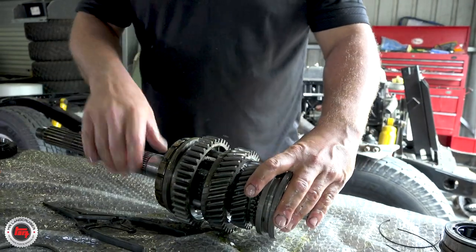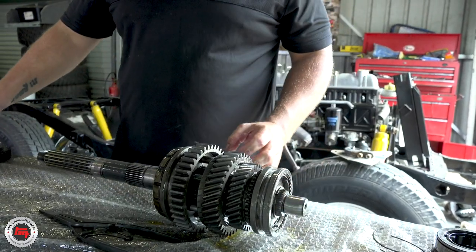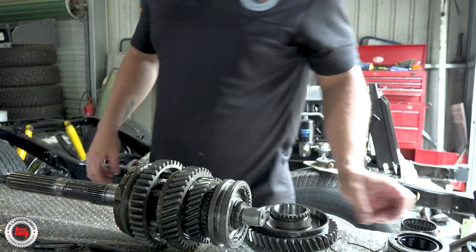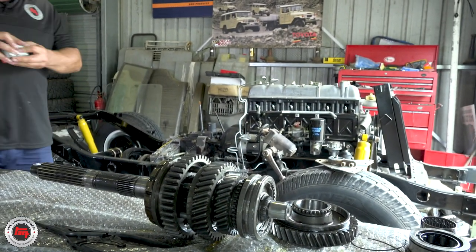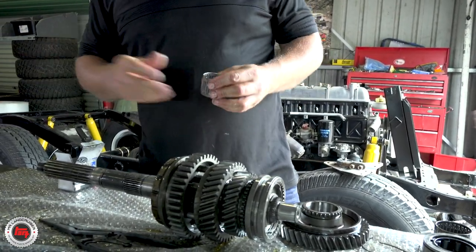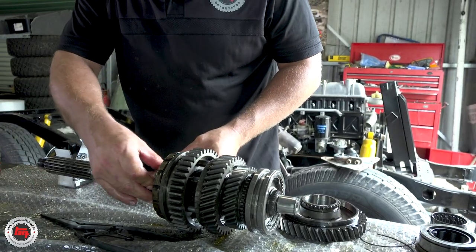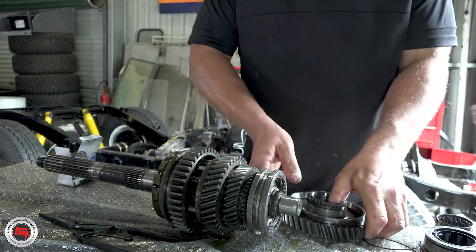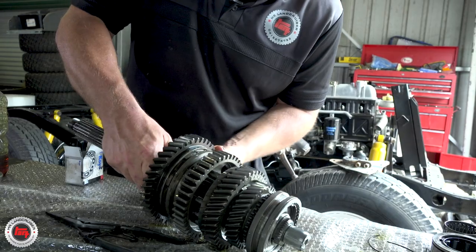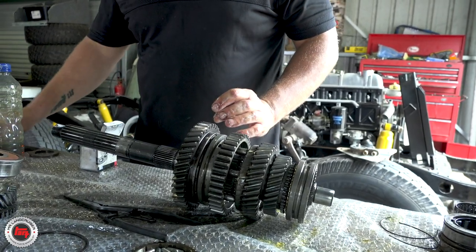I just love lube. So we've got another bearing to replace. That's the old one. You obviously love lube, Richard — what sort of lube is that? We're using the stuff we normally use in the box: Penrite 80-90. As far as I'm concerned, the more the merrier, get as much on there as possible. If you're doing it at home, you can use a bottle — just put a small hole in the top of the lid and use it as a squirter. The whole idea is you soak it in the oil that's going to be in there eventually.